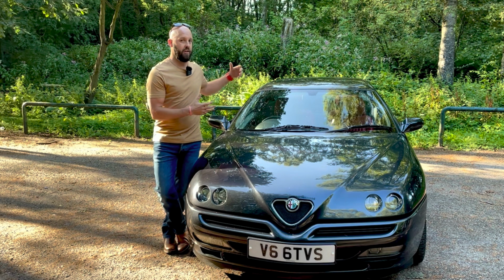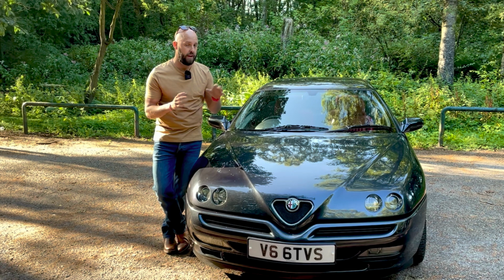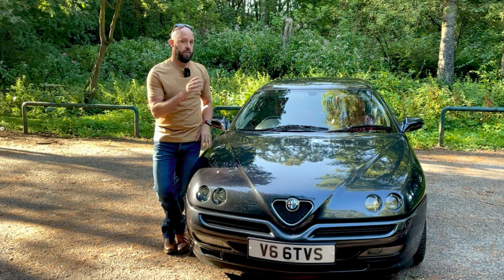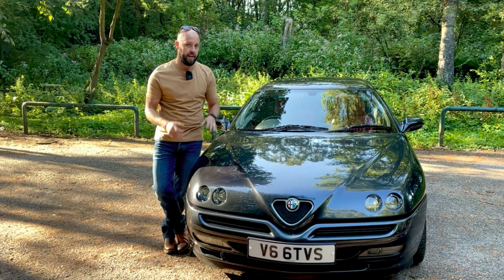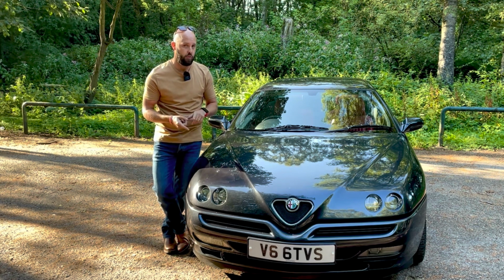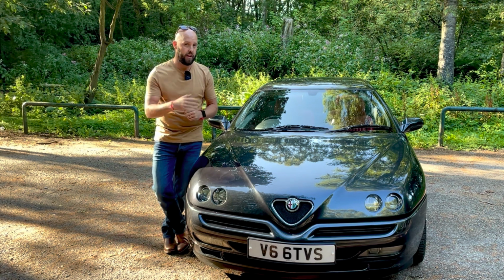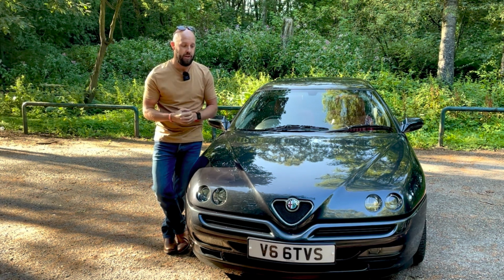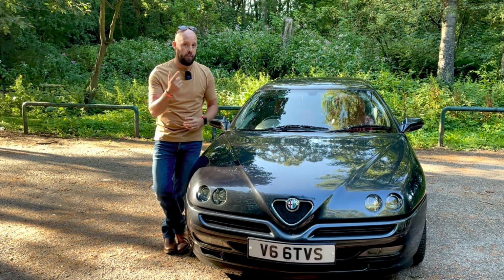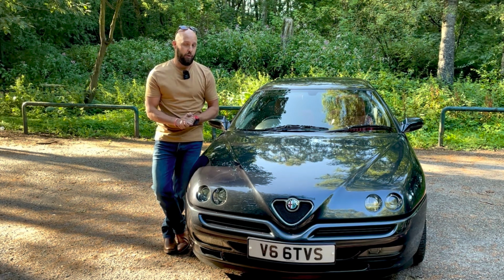Now, obviously, I've already got a full Koni setup. I'm going to stick with those personally, but what I am going to do is remove the Eibach Pro springs, and I'm going to fit OEM specification springs, and that is what this video today is all about. Now, in the future, I do also intend to buy the up-rated Alfaholics anti-roll bar kit. I've heard of lots of you guys who have fitted those with amazing results. So yeah, OEM specification springs, which hopefully should make it a lot less crashy, more importantly, a lot more compliant. I've got high hopes for this, and I hope it's going to work.